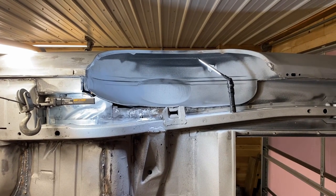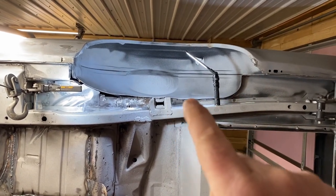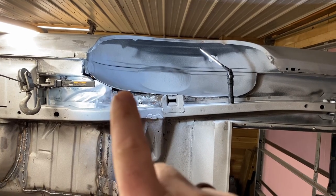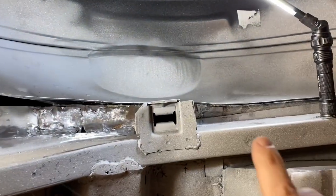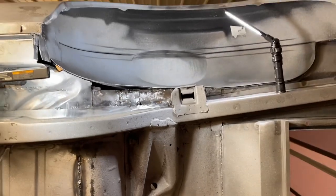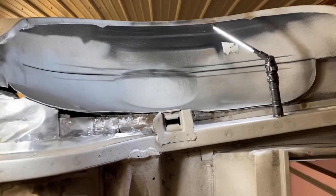Here is my rear driver fender, and a couple of things I want you to notice. One of them is that this curve down to there is not really mirror symmetrical to this one. Looks to me like this is a little bit high and this rides a little higher than there. If you notice closely, this dives back up right here and we got a big gap along this side. So that is one of the things I need to correct. I want to get big fat low profile tires on this puppy and I don't want them to rub.